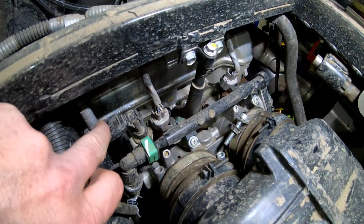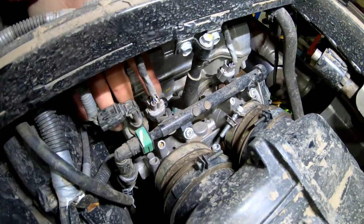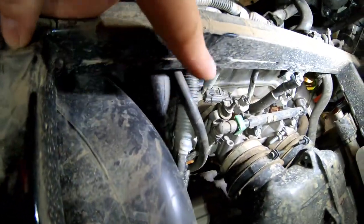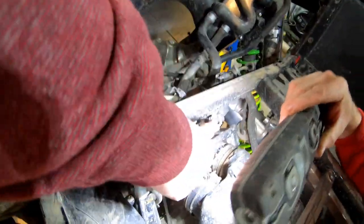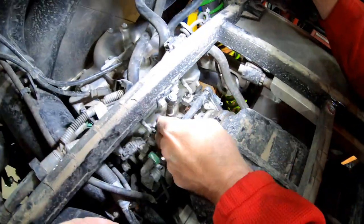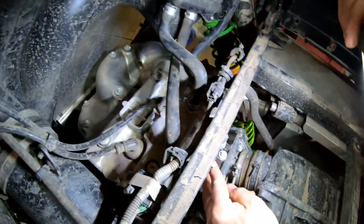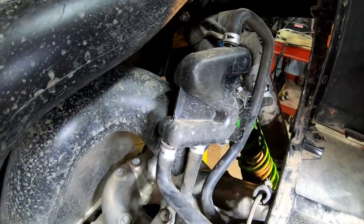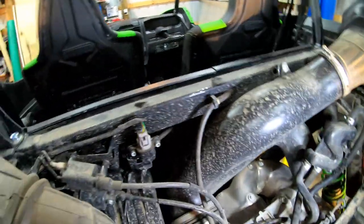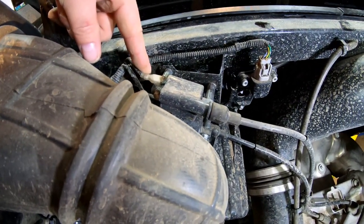There's a MAP sensor with a little tube that goes to one throttle body. There's also a small vent coming right off the motor — looks like a little screw vent — which is the catch can evap canister we mentioned. They keep the coils positioned pretty high up for water clearance, which is nice.